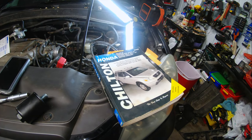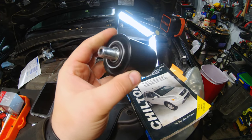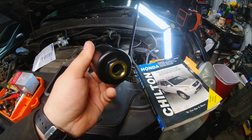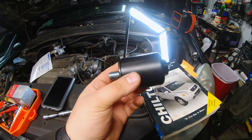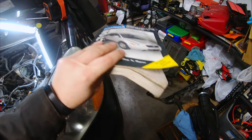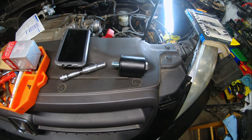If you have a 2003 or 2004 Honda Pilot, your Pilot has an automatic transmission filter that looks something like this — it's a canister-type. The 2005s have a cartridge style, and after the 2006s or 2007s they're in the gearbox and non-serviceable. This one is thankfully serviceable. If you have a manual, it doesn't say anything about this filter at all, but I will show you where and how to get to it.